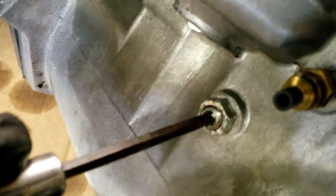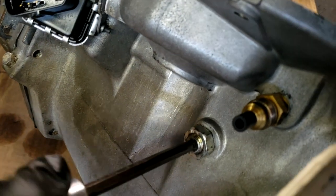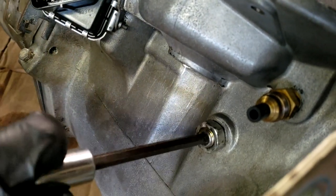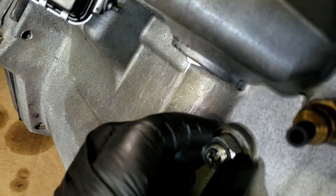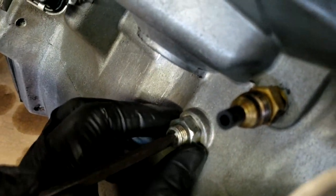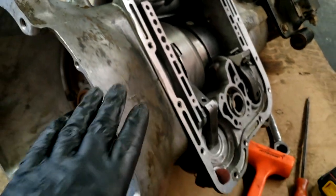Go one turn... back it off. We got to learn you something. Alright, so that's going to be one turn - now go back around. Line it up to the top right there, there you go. Run your nut down, and then that's it - we're going to tighten up this jam nut and then we're good to go. That is the band adjustments on the 46RE, and I believe the 727 will be the same thing.